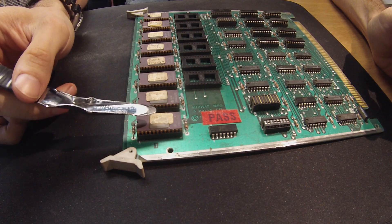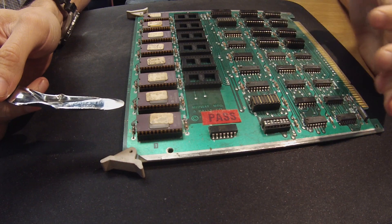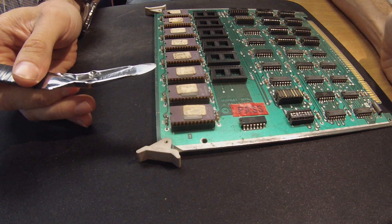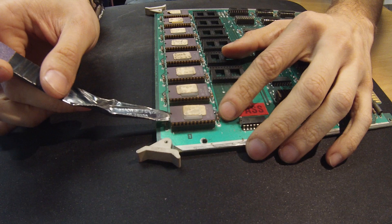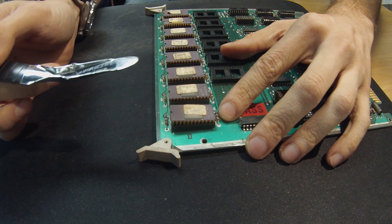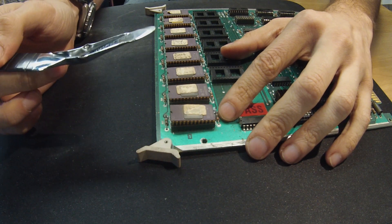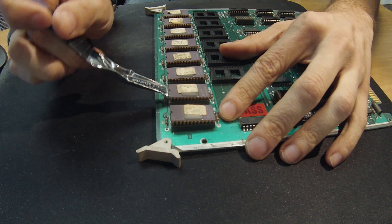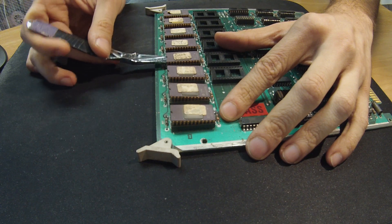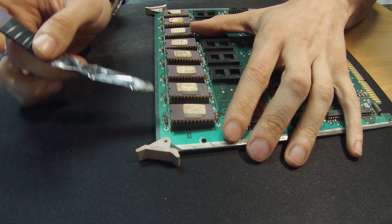It's not as safe as something like this — this is really light and the perfect thing to use. So the first thing we'll do is take our staple remover or screwdriver and figure out which chips we need to re-seat. You can re-seat all of them; it's fairly easy to do, so if you're in there you might as well re-seat all of them anyway. So first, you ease the staple remover underneath the chip and lift it up just a little bit. There will be a slight cracking noise as the chips probably haven't been moved in decades. What we're doing here is trying to establish a new, fresh connection between the chip seats that are soldered to the PCB board and the chips themselves.